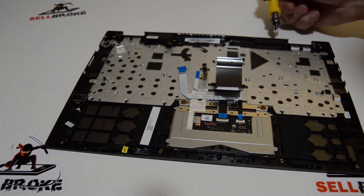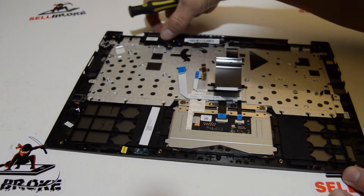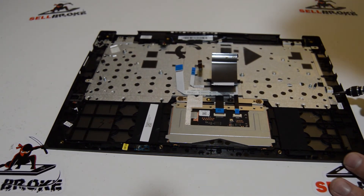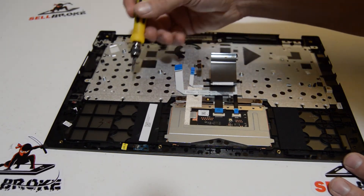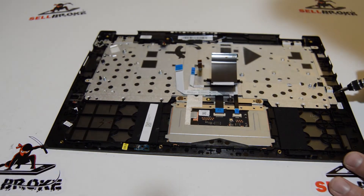We're going to leave the two speakers — they look like they're just held on by some rubber grommets. The keyboard is not generally replaceable because of these little melted plastic rivets poked through it, though I do see a bunch of tiny slotted Phillips screws, so the riveting might actually be for part of the palm rest bracket.